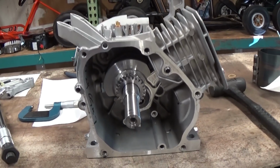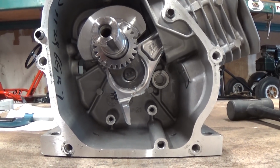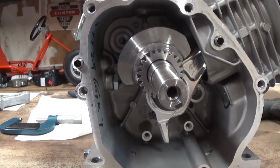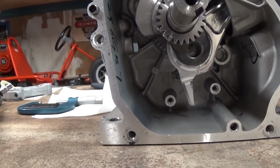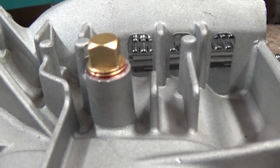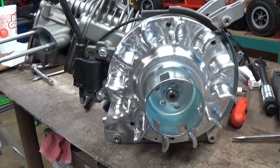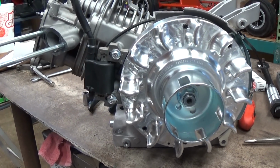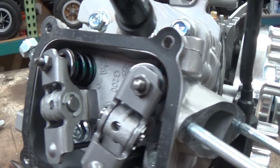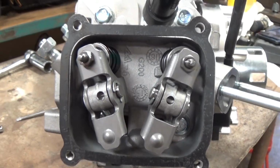Seven days since you left me. We got the engine tore down, got the billet rod in, got the oil sensor out, got the governor out, plugged up the oil sensor wire hole, and drilled and tapped the 1/8" plug in the governor rod hole. Got the billet flywheel on, the coil back on there. Got some 18-pound valve springs so it won't float at high RPMs.